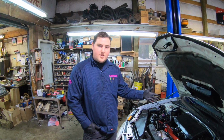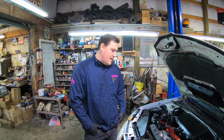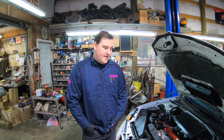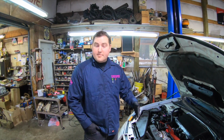A lot of unknowns on this car, so we're going to kind of have to comb through it a little bit and see what we got going on. It's got a fairly large turbocharger on it and some pretty big injectors that we need to figure out what they are so we can scale them properly. And we'll see if we can go through a full pre-dyno inspection, get on the dyno, clean it up so it runs good, drives good, and it's a real good car long term.